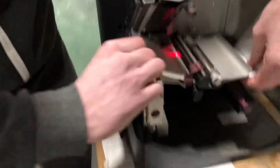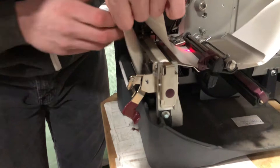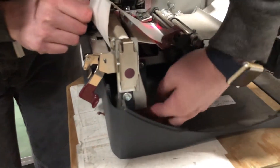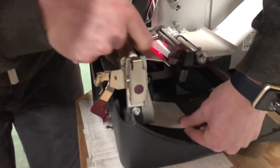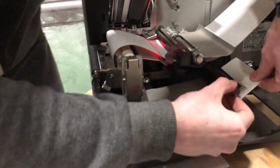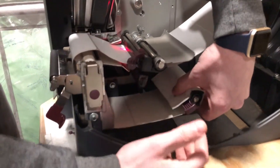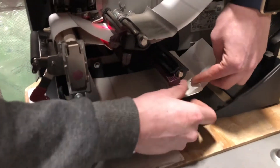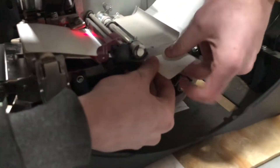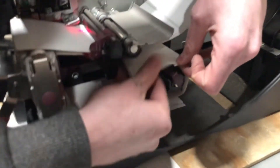Next, we're going to keep pushing the label forward, then through this gap here, we're going to feed the label down under this bottom bar. Then we're going to pull it back to this spindle here. Unfortunately, this spindle doesn't grab the label very well when we start peeling and it tries to wind. So a little trick I like to do is peel back the ribbon a little bit and pull the label forward.